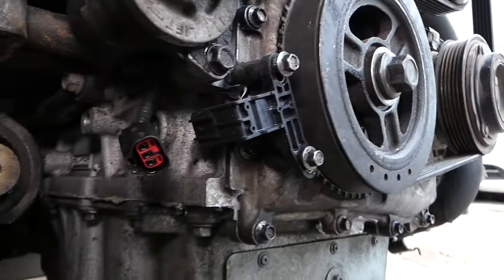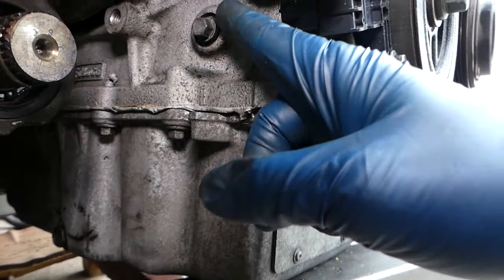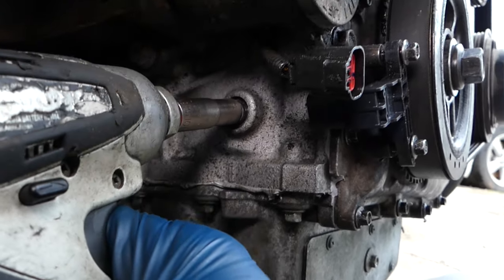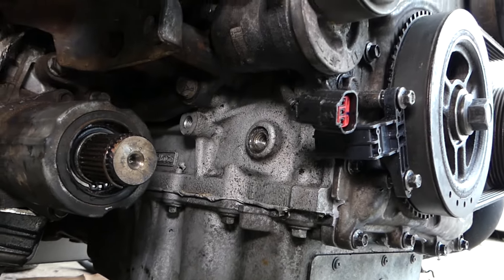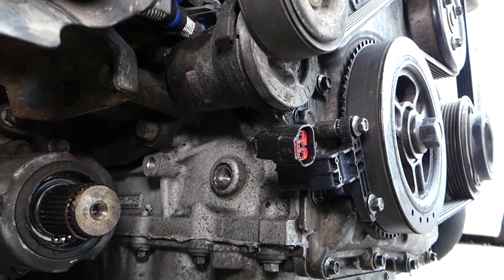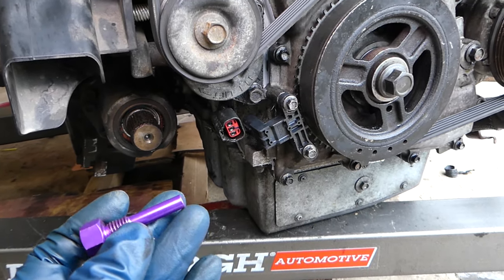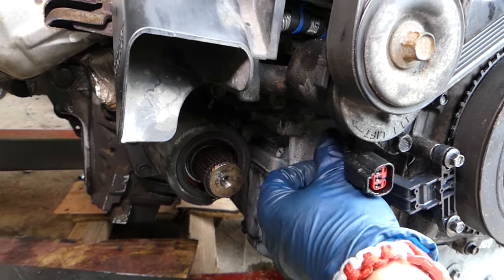You don't have to remove the engine out of the car, but we can show you a little bit better here. On the back side of the block you have one bolt — usually a 10 millimeter socket, though it could be a different size. I'm going to go ahead and remove that now. You need to bring the engine to top dead center — TDC — on cylinder number one, and you will need a special timing tool. All the tools and parts we use will be listed in the description below.